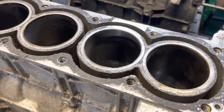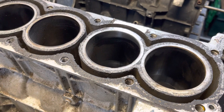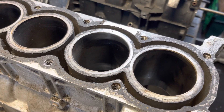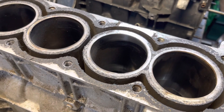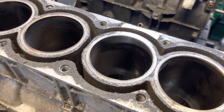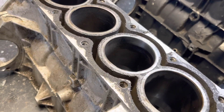This is a dry casting liner. If you can imagine in the factory, before the shutters came in for the side of the die cast and the aluminium was poured in, they had the four liners sat on spigots. Then the shutters came in and they poured it all in ally, so when it cooled down the aluminium was fully coated all the way around the outside of the liner. So it's called a casting liner, and this works a treat.